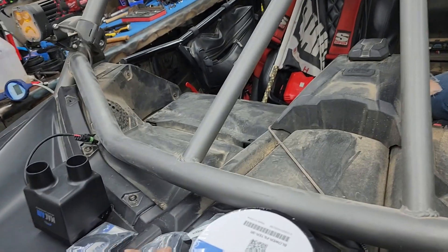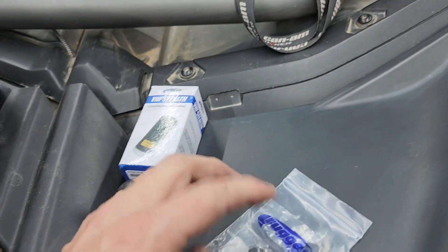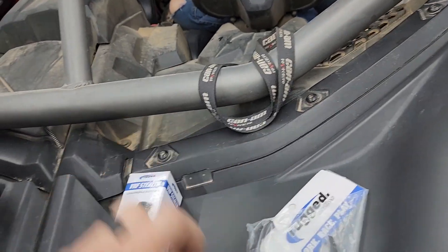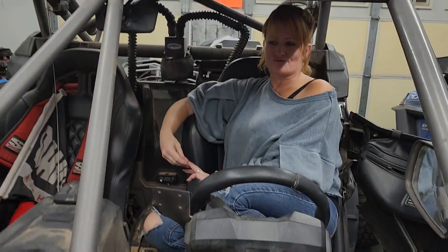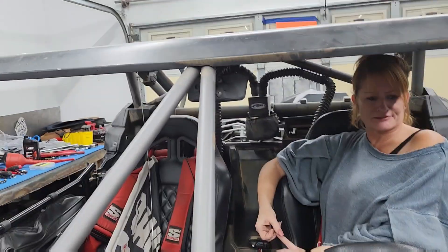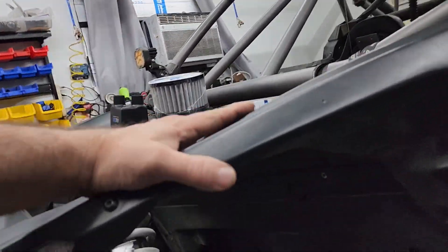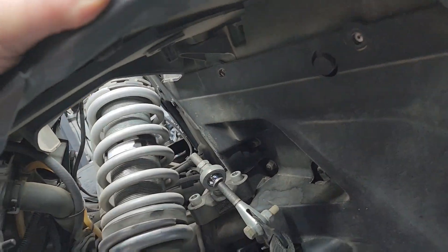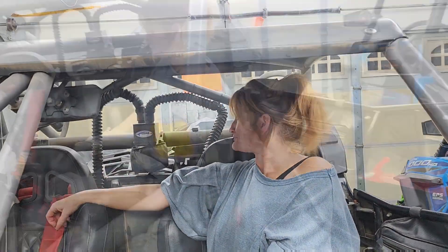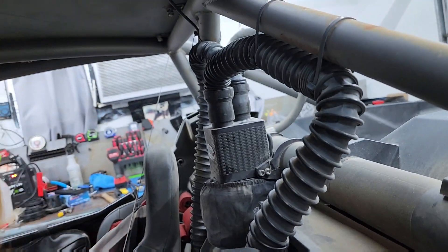It comes with a new filter so we're gonna be putting a new filter on. We're also going to add this hose holder, and then it connects with that guy — just push down. So we're gonna do that, reconnect the sway bar, and then remove the old bumper. Car's dirty, don't worry about that — we're gonna clean it.